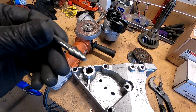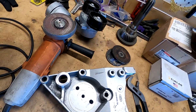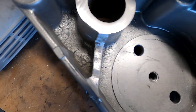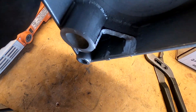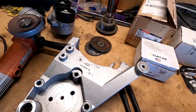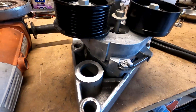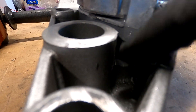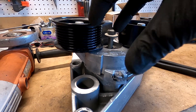This is actually a non-ferrous metal burr on a die grinder, and I just went through and cut the rest of that back. You can kind of see here how that came out - luckily, it's completely hidden so it doesn't really have to be pretty; it more or less just has to be functional. But you can see now we got it cut back really far. And when we get our tensioner in there, you can see we have a ton of clearance room between those two pieces, and this tensioner is going to have a lot of room to rotate back and forth.